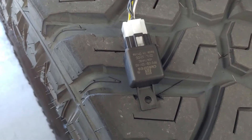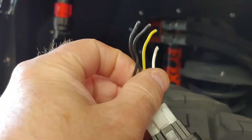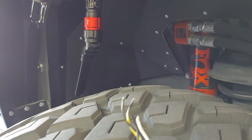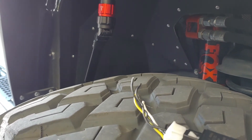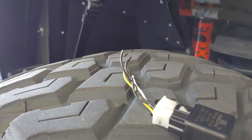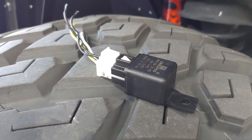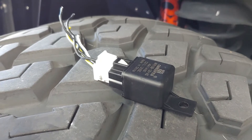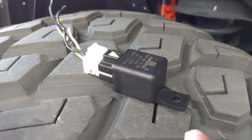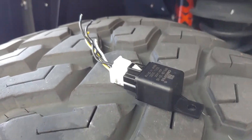One way to trick the system is to use a relay. On these kits, the yellow wire is your turn signal wire — you tap directly into it, and it feeds power to the relay that energizes it. The white wire taps into the white wire in the factory harness and runs it to ground. When the yellow wire gets the turn signal power, the relay energizes, which adds an additional load to the circuit. That tricks the module into thinking the LED is present and not burned out. When the power on the yellow wire goes away and the turn signal shuts off, the relay de-energizes.